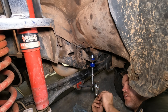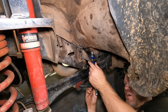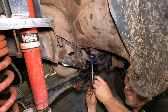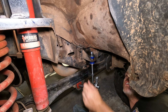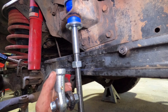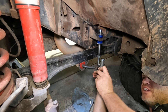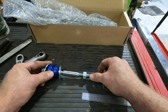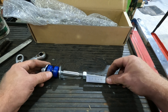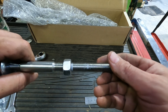Mount it on the outside for now so you can see where to line things up. Push that up and remember once you've tightened this up it's going to give a little bit — just rotate that rose joint around and try and hold it square, then wind that nut down to roughly where it looks right. With that all in place you've got a little bit of slop in the rose joint. As long as you're happy with the alignment, put a little white mark there — we'll measure from there down roughly 30mm.